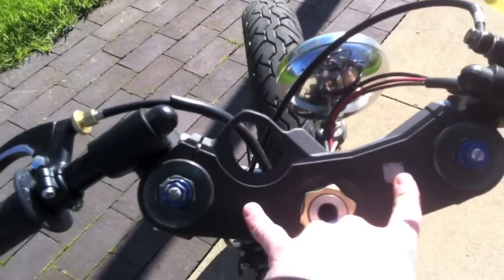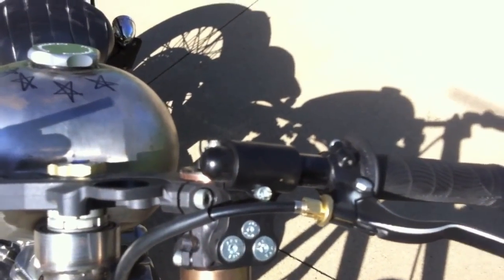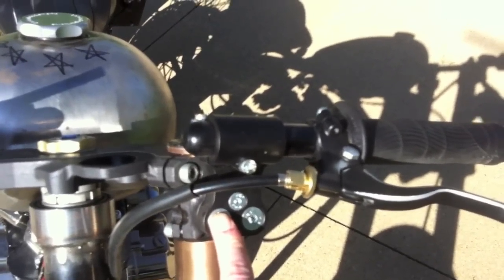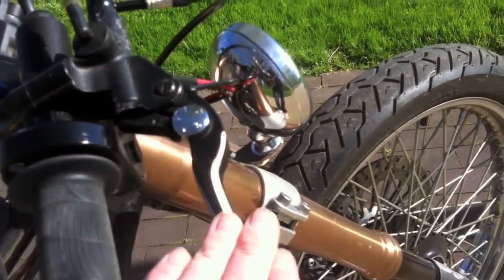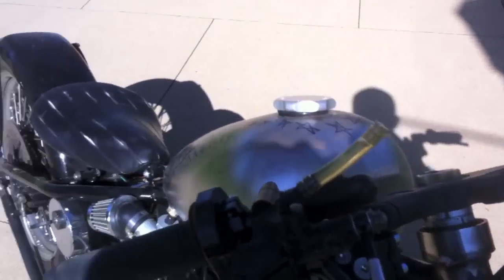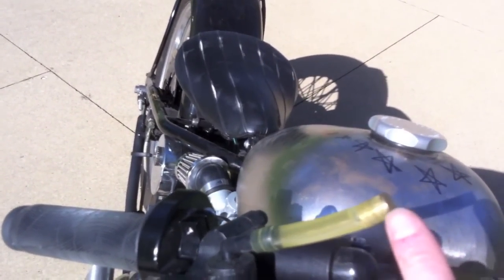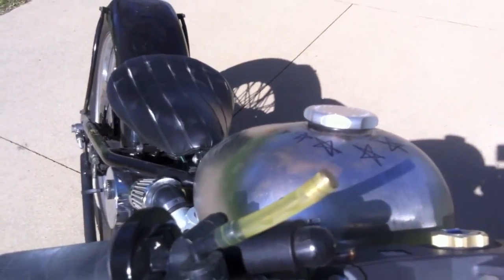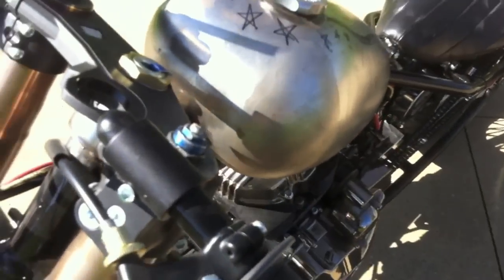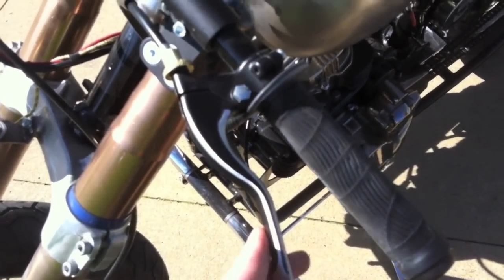For the bars, I didn't want to mount anything up top, so I bought some Woodcraft clip-ons that fit the GSXR forks. These are Woodcraft clip-ons with the Healy bar — they have a two-inch rise over stock, so it's a really comfortable feel. I'm using a stock GSXR lever that was cut and weathered a little bit for an old-school look. I removed the brake reservoir and put a small piece of tubing with a lathed brass piece in the end to stop any fluid from leaking out. The lever itself is just a cheap $7 eBay lever that I cut down and shaped a little bit.